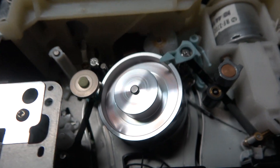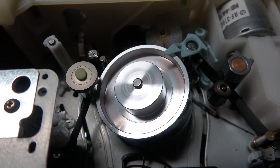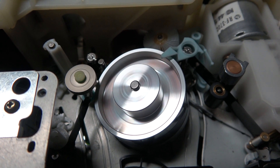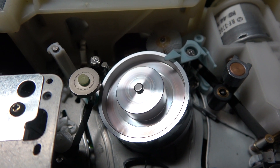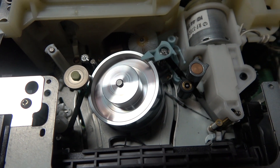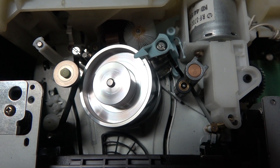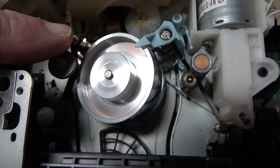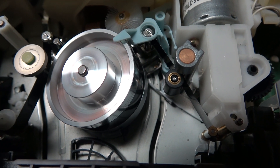Between every tape I'll have to go back and realign the machine. If all their tapes have drifted the same amount I shouldn't have to adjust much, but once I'm done I'll put in a tape recorded on one of my own cameras years ago and bring the machine back to its normal alignment starting point — because you can get pretty messed up when you start tweaking guides back and forth.